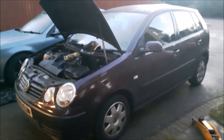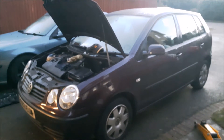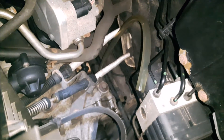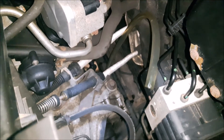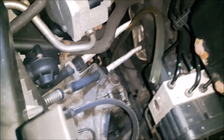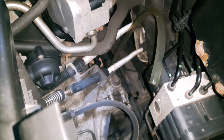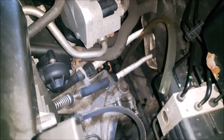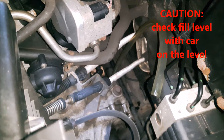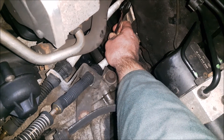To drain the oil from the gearbox you'll have needed the car on its axle stands, and whilst it's up on its stands you can put the first litre of oil in — but once you get much beyond that the oil starts to come back out of the fill hole. In order to check the level, the car needs to be on level ground; the gearbox has the right amount of oil in it when it just reaches the bottom of the hole on the inside of the box. With the front of the car raised in the air, the gearbox oil rushes to the back of the box and gives you a false reading — you will end up with a gearbox that's got an insufficient amount of fluid in it.